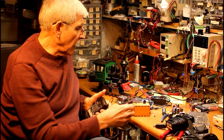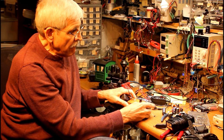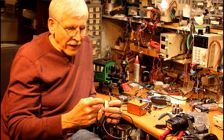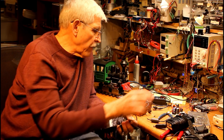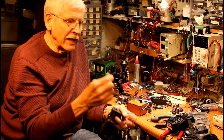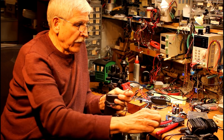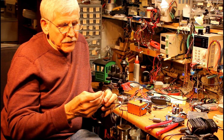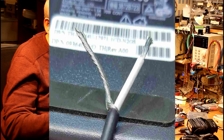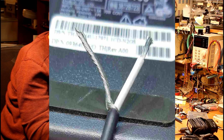What you need to do — if you're lucky enough to have a plug on the end that fits into a female receptacle you might have, you can just plug it in and you're in business. Many times, though, there'll be a strange end on it. This is a little rectangular plug that goes into a Dell laptop. What you need to do then is cut that off. Let me cut this fresh so I can show you exactly what to do. The wire that went into the laptop needs to be stripped, so get your wire strippers out. I'll pull the insulation off, and what I'm finding is some braid — that is typically the negative terminal, the minus connection.